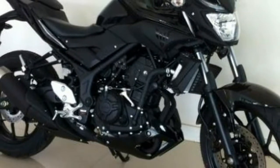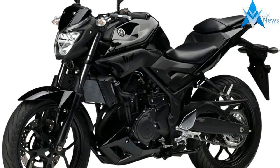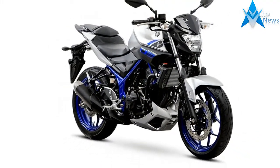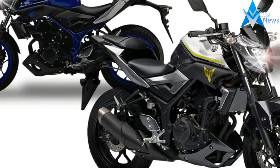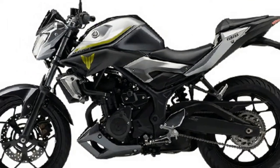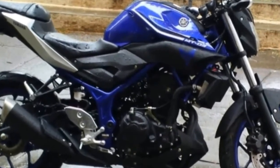Chassis components are adequate as per traditional Japanese standards. Front fork is a 41mm, classic-looking unit set at 25 degree rake to produce 95mm trail. Front brake is by single 298mm rotor and 4-piston caliper. Tires come in 110/70-17 and 140/70-17 sizes front and rear. Wheelbase spans 54.3 inches, which should make it adequate for a comfortable 2-up ride. Seat height is an accessible and confidence-inspiring 30.7 inches.